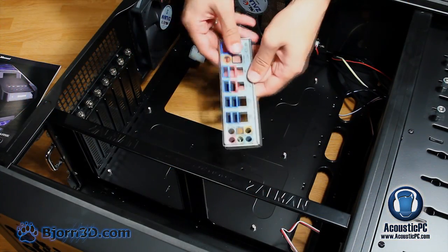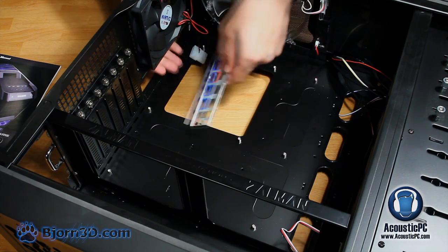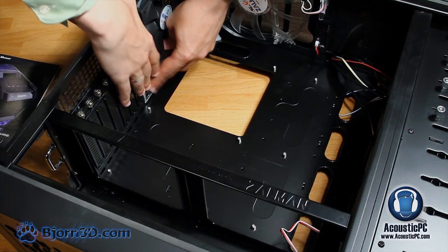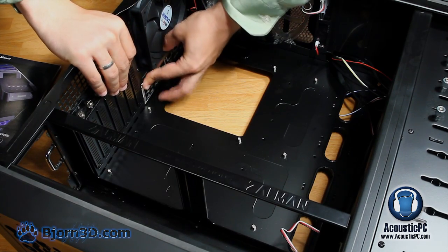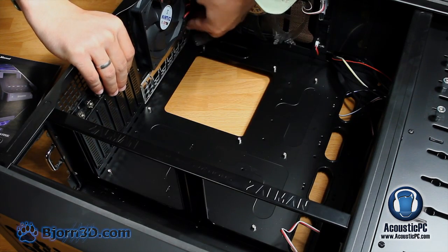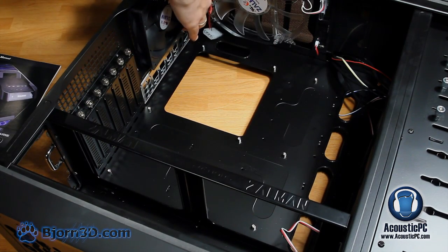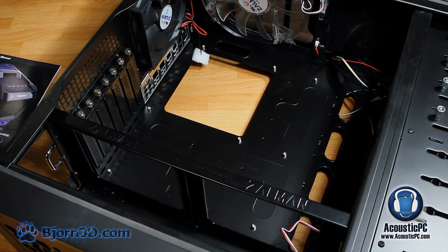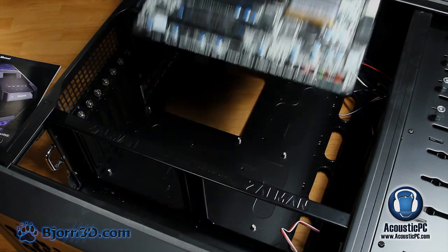Prior to the installation of the motherboard, let us install the I/O shield plate in the back of our case. This can be done by simply positioning the plate against the opening in the back of the case and applying pressure. Make sure also that the I/O shield plate matches the ports in the back of the motherboard. The pins on the plate should fix the plate in place. Make sure to apply pressure in all 4 corners of the plate, making sure that the plate is secure.